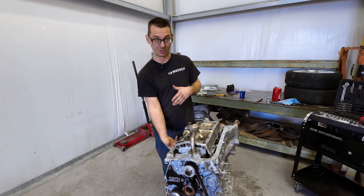We're going to put the rear main seal in it and then slide it over the crank, and then we'll start doing the windage tray and stuff. That feels pretty level. Now we're going to put some RTV on here. I'm going to get the assembly lube and lube up the inside like I did with the other stuff so it slides on nicely. Got all the bolts ran in, final torque on the rear main, and then we'll move on to the windage tray and the pickup tube.